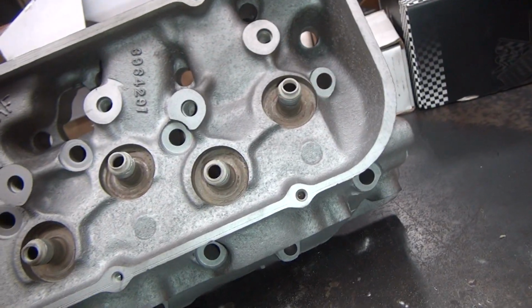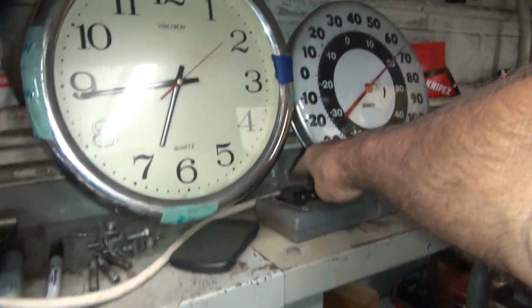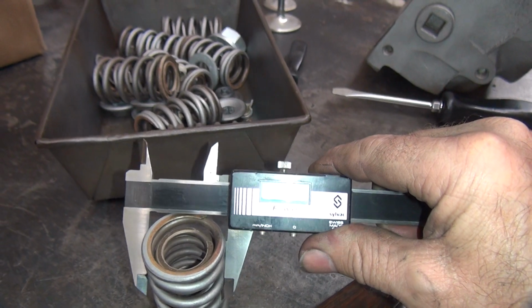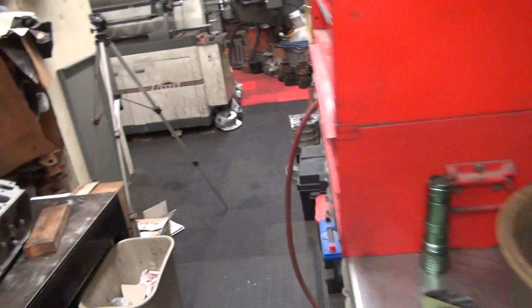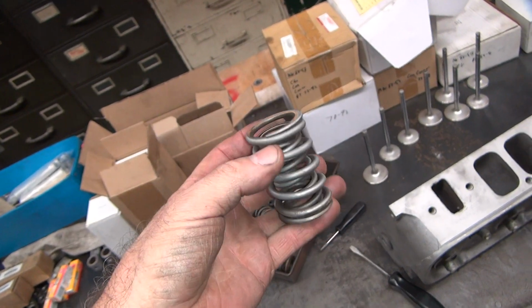Looks like you got them cut out for decent sized valve springs already. Oh, how big are these stupid springs? They look like they're less than 1.5 inches. Maybe about 3/8 or something. Oh, they are 1.5 inches. Okay. That's decent. I don't like 1 5/8 on hot rod motors, but nowadays you do a beehive spring in there or a conical. Conical's better than beehive.